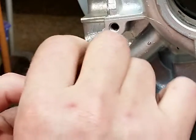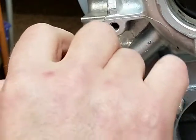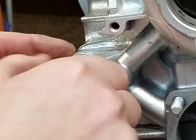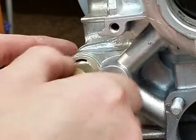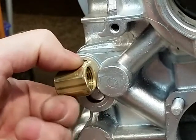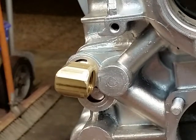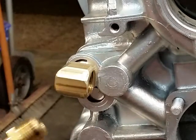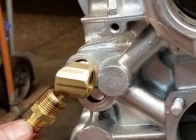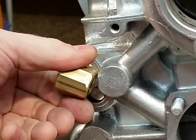So when you go in here like Easy said and you put your fitting in and you start to turn this thing — because it's a tapered bit — it can crack the case. Easy doesn't really have to go that far because the purpose of these fittings is to seal up the threads and the fitting really nice. So as you turn it and it gets really tight, it always makes me nervous to go any further to get it all the way around where the fitting is gonna go — maybe nine o'clock, maybe seven o'clock or whatever. It always makes me really nervous to just keep going and force the issue and crack the case.